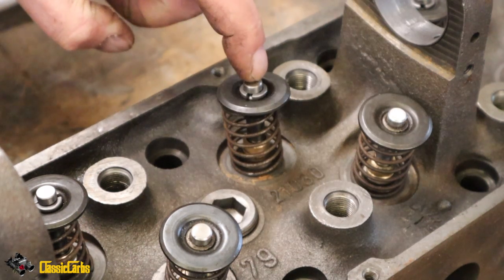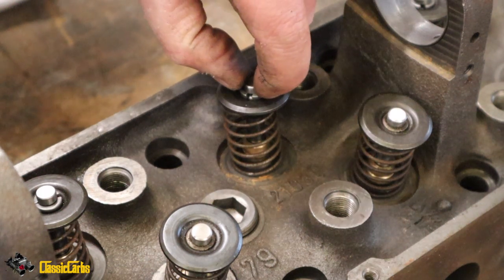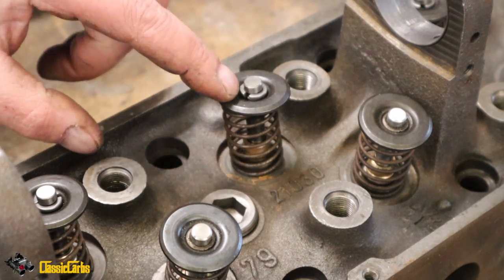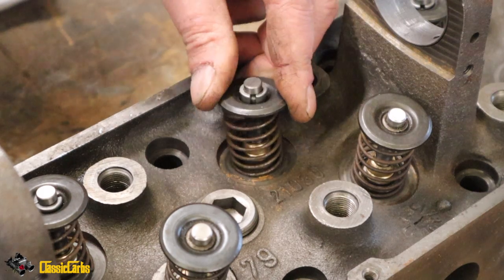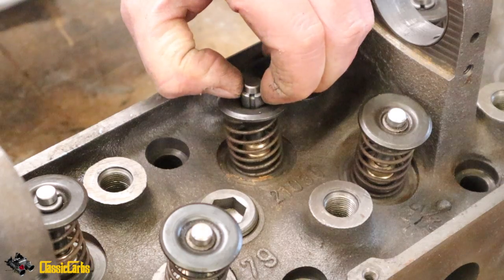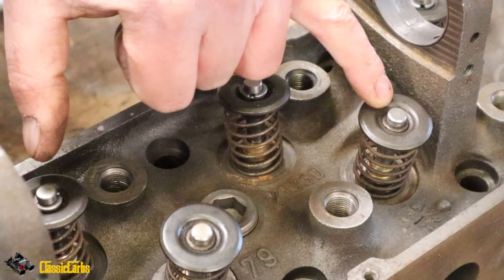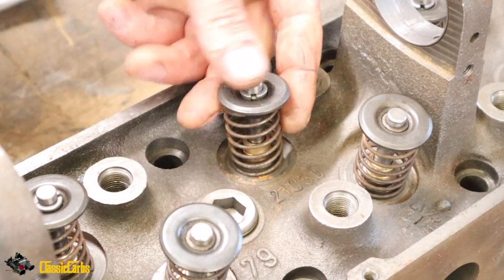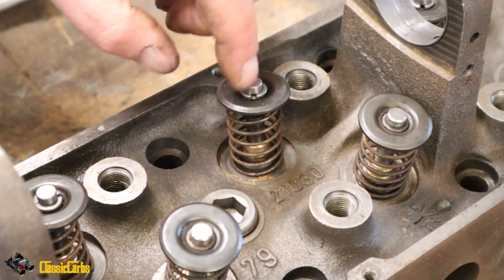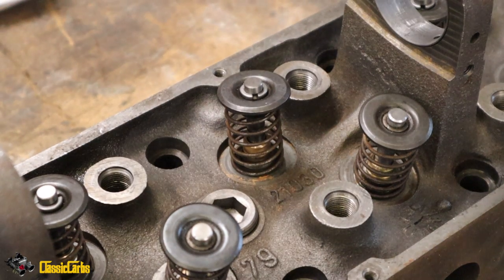We bought these from Burton Power, the valve and the cotters, the retaining things. And I don't think that looks right. That gap there shouldn't be there. It's not a case of lack of fitment. It doesn't matter what the cap's doing, these things won't close on the valve. As you can see, that's the original, and that's how it's supposed to look. So I've written to Burton Power, and hopefully they'll offer to send us another set of these cotters to get this right. Because it ain't right.